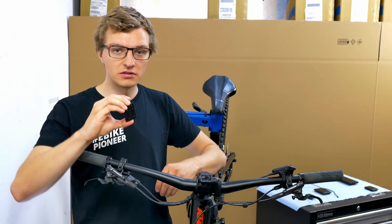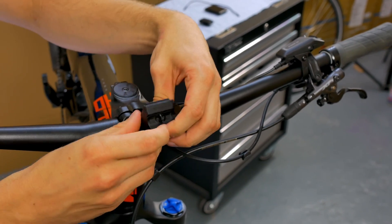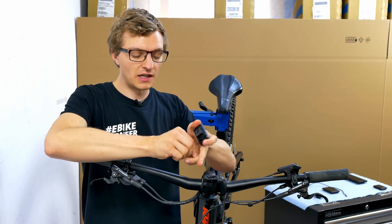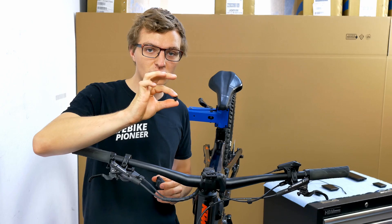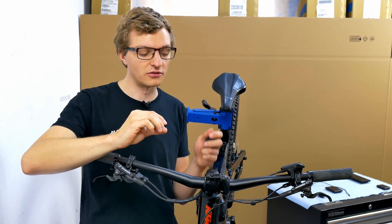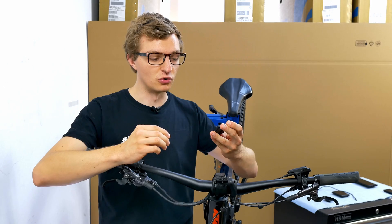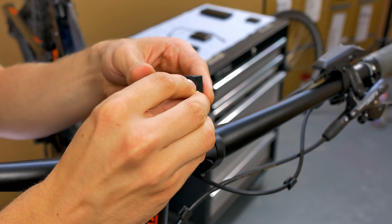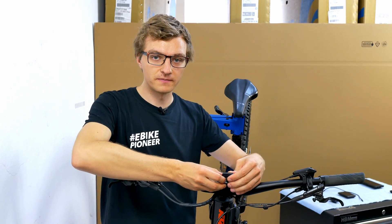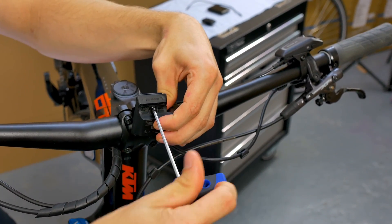Once you have roughly mounted the one arm holder so that you can still move it to fine-tune it, the next step is to attach the display mount to the holder. This works very easily by inserting it and tightening it with the appropriate screws, also with the 3 mm Allen key. Here's a little tip: you have the option of fitting this tiny anti-theft screw, which prevents you from removing the display once it has been attached. The display is firmly attached to the holder and can only be removed if you unscrew the entire display mount from the holder. If you want to use this option, you must insert this small plastic plate into the display mount and then attach the whole thing with this lock. In our case, we prefer to have the option of removing the display — for example, when we go to the store — especially considering that it is now also possible to use the display for the e-bike lock function. So we simply leave out the security plate and screw the display mount onto the holder.